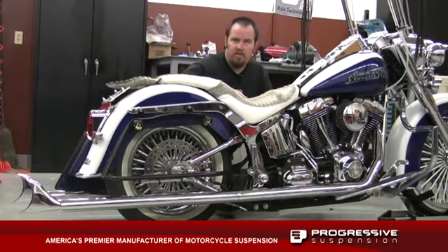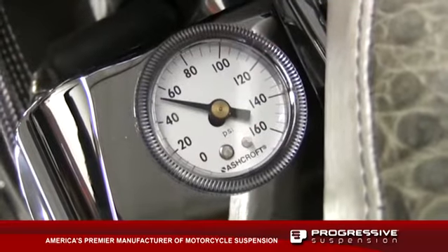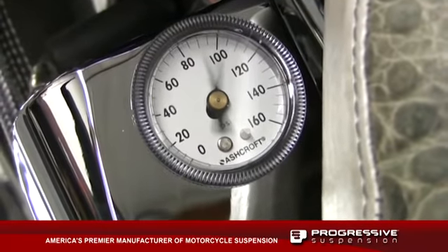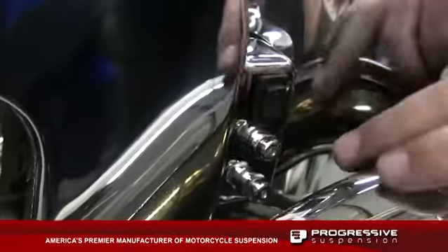On this bike we're actually able to get about four inches of drop. The gauge monitors system pressure — it is designed to leak down to zero over time, but this does not impact the pressure in the system. To check system pressure, simply toggle the switch.